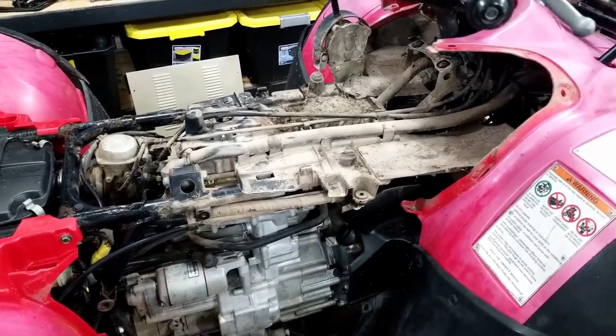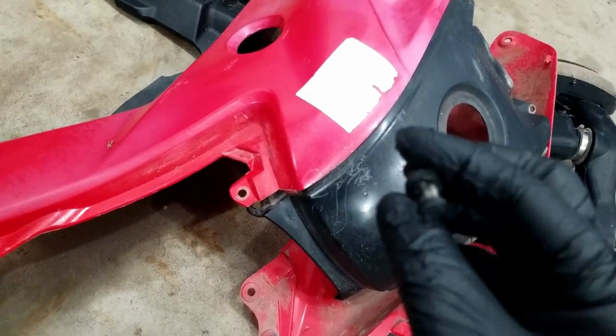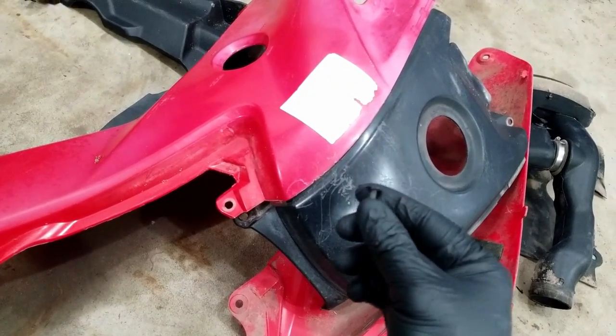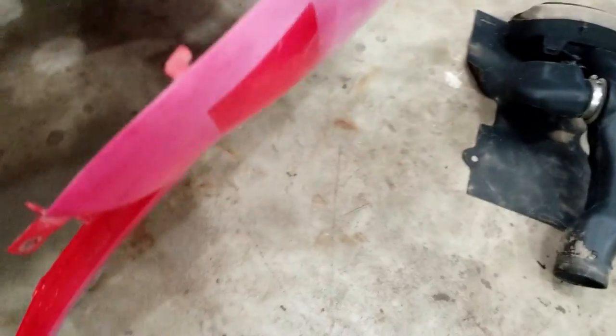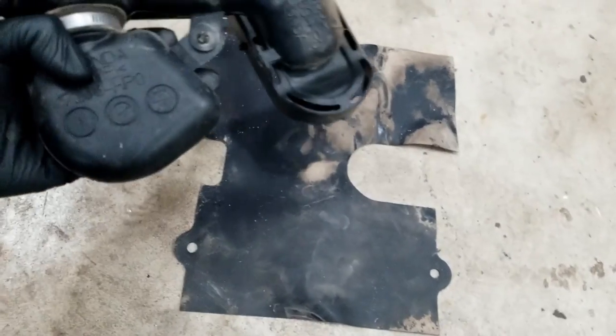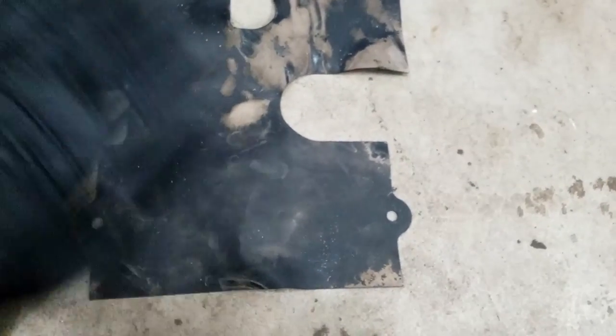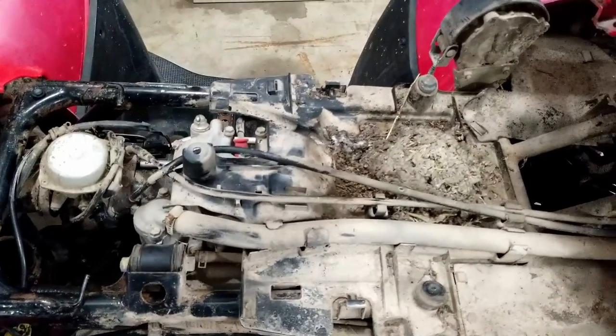In order to get to this position you basically have to rip off all the plastics and remove the tank. Here are the factory plastics — they are held in by a bunch of little plastic rivets. I guarantee some of them will be gone and missing, but when you're tearing it apart make sure you go gentle and don't just pull, because there are a lot of hidden ones and you can wreck your plastics pretty bad. On top, move your breather that goes to your airbox and the piece of rubber underneath it by removing a Phillips head screw — that whole assembly basically slides off.